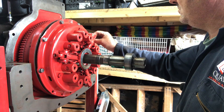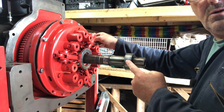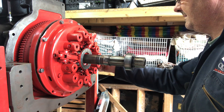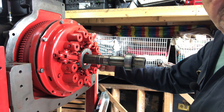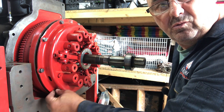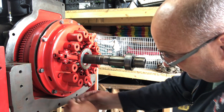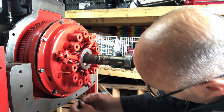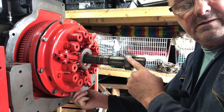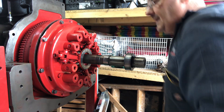In a couple of previous videos I've been talking about the PTO brake and how this piece here is where the PTO brake works — a strap comes across with some friction material on it. Well, I found out today it's not a PTO brake at all. What it is is a gearbox brake, because this is to stop your gearbox from rotating so you can change gears without taking the edges off your gears. So that's what that is.